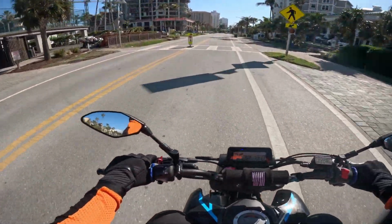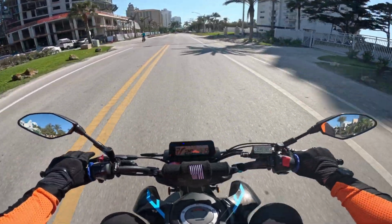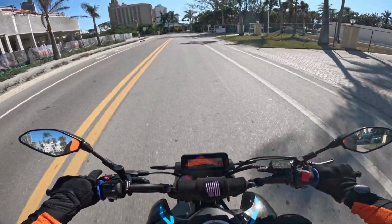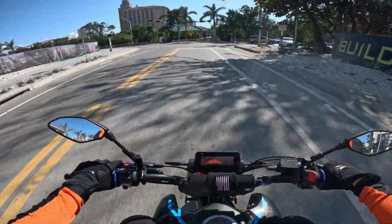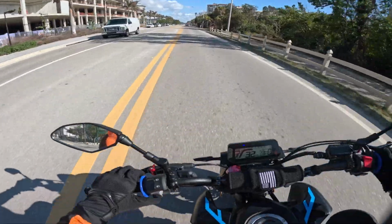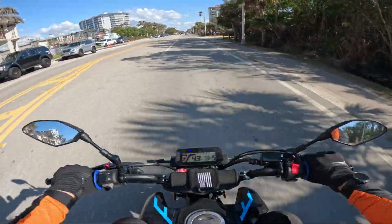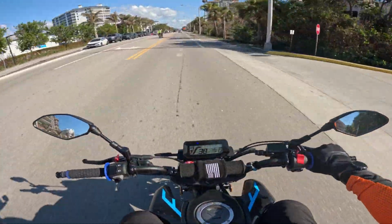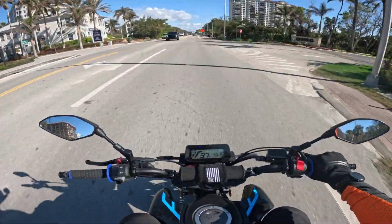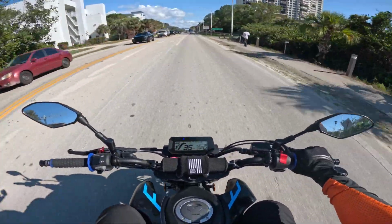I think the bike's fueling was a little bit better with the DHM tune on here, and I think it pulls a little bit harder to redline, but I'm hardly ever pushing this bike to redline as it is, because most of the power is made before 7,000 RPM, I would say. All right, so I don't really recommend tuning this unless you get a cam. Then I think it's absolutely necessary, but I don't think a cam is a top 5 mod on here, honestly,